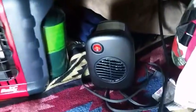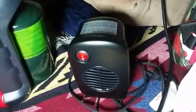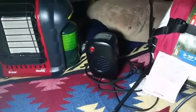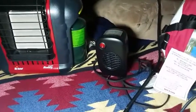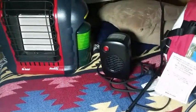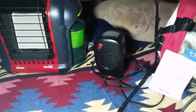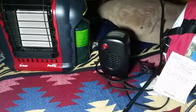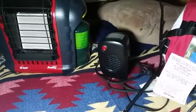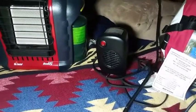I picked up this little guy from Walmart — it's a 250 watt electric heater. Small little guy, but it definitely takes the chill out. It'll work depending on different areas around the country, and depending on how well you insulated your vehicle. It also depends on if you have shore power and whether your inverter can handle it. 250 watts — pretty sure most inverters can handle it.